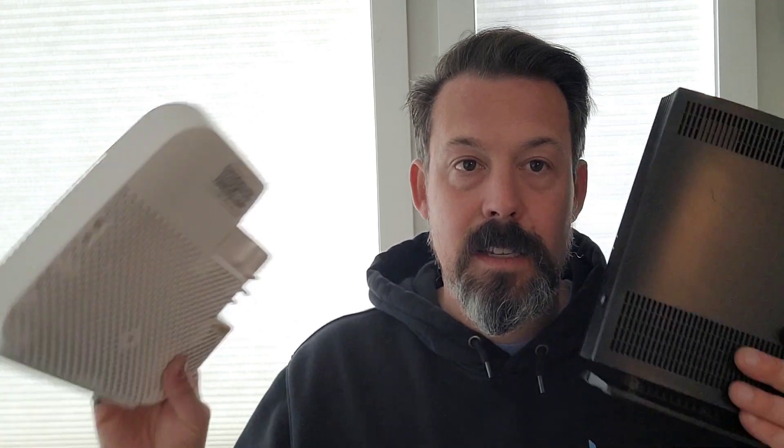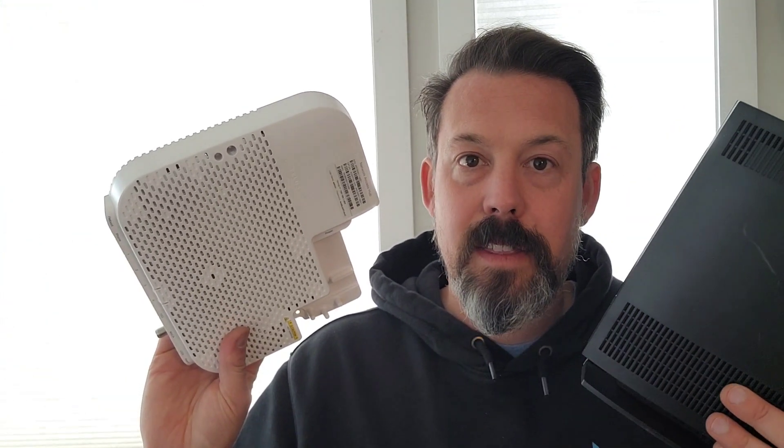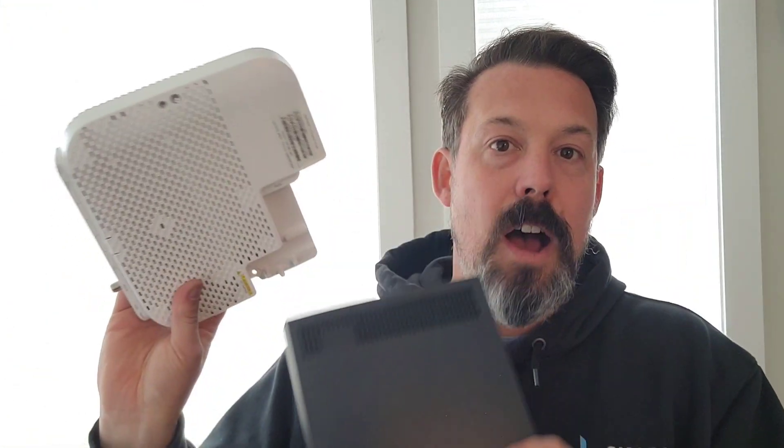The easiest way to set up your router is so it has a public IP address — it's talking to the internet itself. If not, you'll be behind a firewall and all the traffic you're sending out hops through one of these. It's a double NAT. It'll slow things down and could possibly make your network not work at all, depending on the IP address of your router.